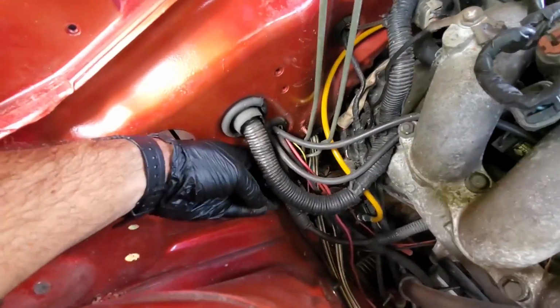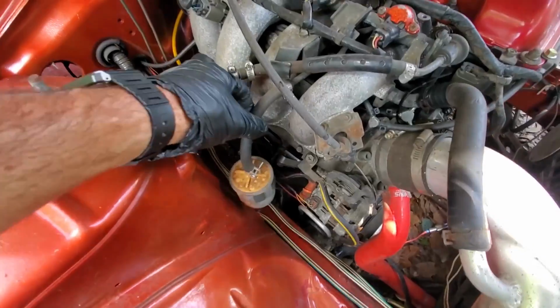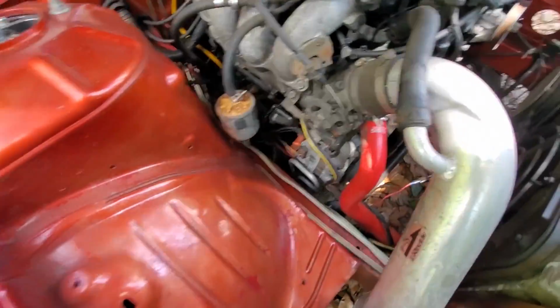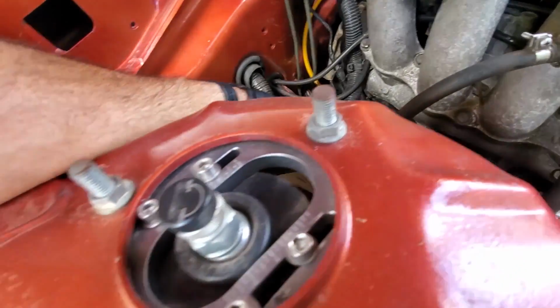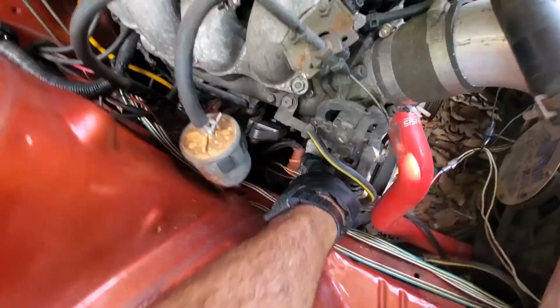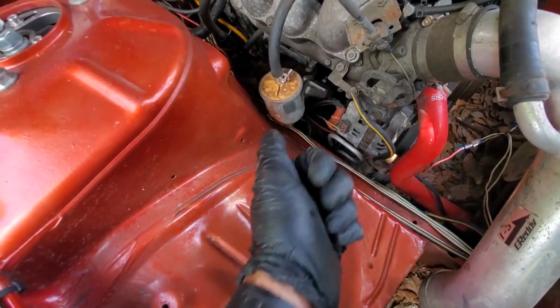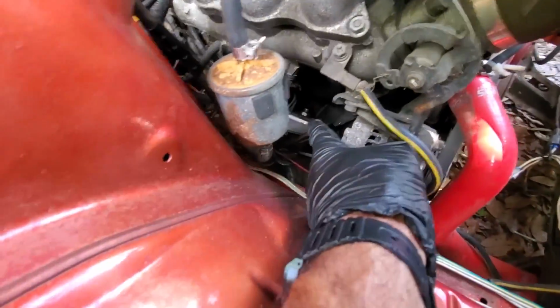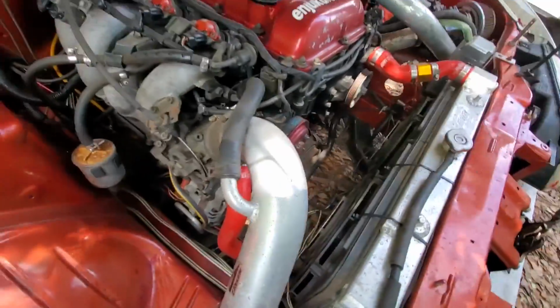But we've already wire tucked this engine bay, so everything's real simple. Those are all the wires. Those are the entire wires that run into the car. Everything else is inside. So we just undo some stuff. Everything's happy. We're gonna take some fuel lines off. Battery cable. Where's that battery cable run? Okay, so we got the positive and negatives right here. We go to the block, into the alternator, undo those. Then we got to unbolt the downpipe, unbolt the engine mounts, get the exhaust off of there. And then this thing is free.